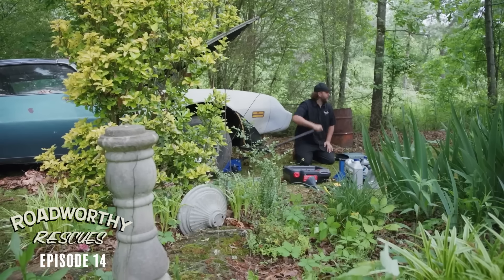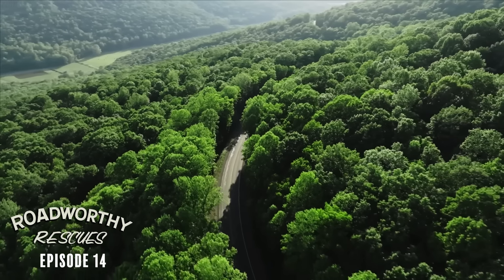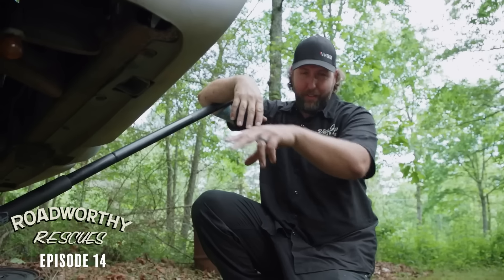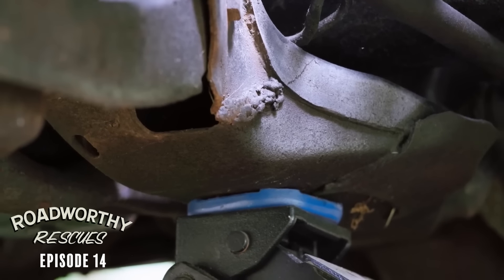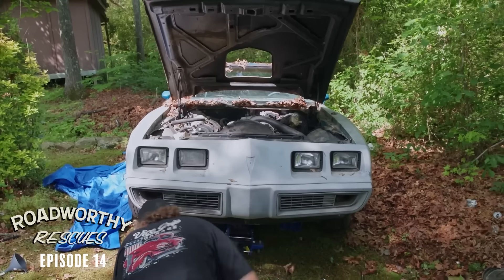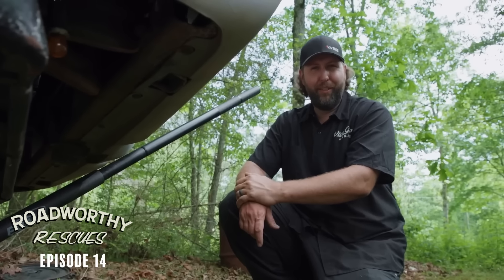That's fantastic news. I'm going to drop the oil on this and change that out. We can check the coolant and the radiator up front. It probably doesn't have brakes because the rears are completely disconnected — and we're at the top of a mountain where the first thing we do when we take a left is drop like 74 million feet right into a small town four-way flashing red light, so I'd kind of like to have brakes. A guy slid under the front of the car, and unfortunately the crossmember has been completely ripped, split, cracked, and broken. Someone stick-welded it with their eyes closed. There's still a crack above that — the lower control arm on the driver's side is about ready to tear off, and nothing is true, straight, or correct in the steering or alignment. But since it's a tribute replica Burt car, it means we can jump it now too.